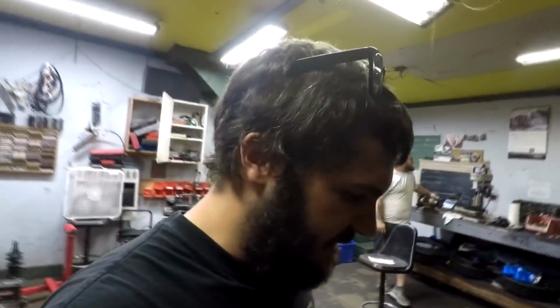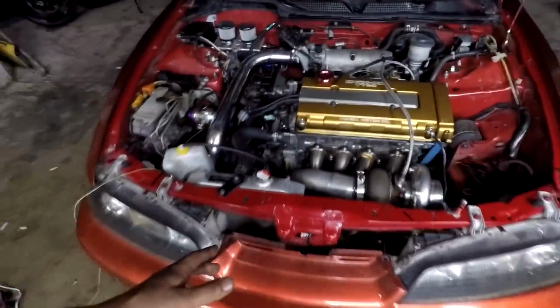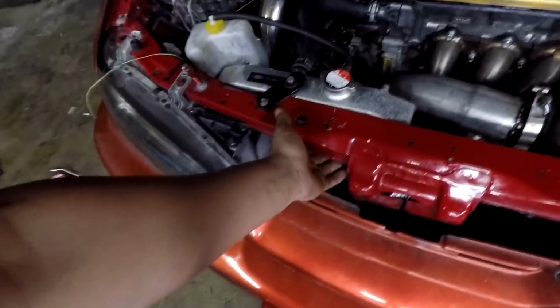Right. Okay, so anyways, guys, just kind of wanted to go over some of this stuff with you guys and let you know that the car is running great again. And we got the boost solenoid plumbed up. I still have to wire it. The other end of the whole boost by gear thing here is once it's all plumbed with the vacuum lines, you have to run the wiring into the car. So I have one of the wires going into the cab of the car, and I'm going to run that to, I forget what it is, A10 or A12 or something like that.